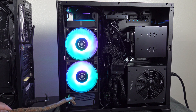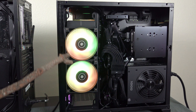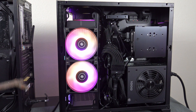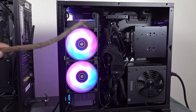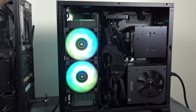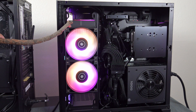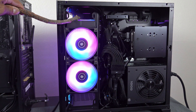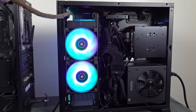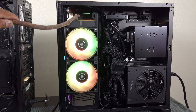Many of my viewers asked why are the fans on the rear of the radiator here — shouldn't they be on the front? Well, that's somewhat personal preference. I actually like the way it looks with a little RGB glow going through the radiator. But the reality is there's no space — you cannot fit these fans on the front of this radiator because the distro plate comes too far in, so it's not possible to actually screw these into the front.